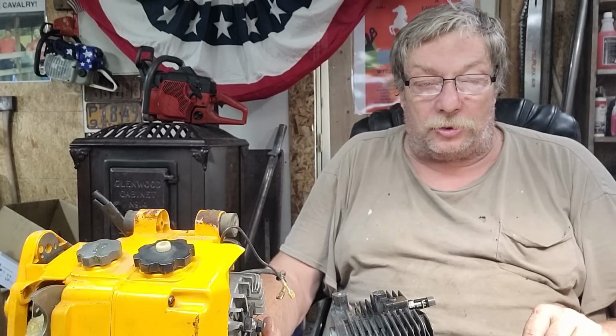You start crowding numbers too far in any direction, all of a sudden you start having failures. Okay? Yeah, you can crowd them more than I'm doing, in some cases. I seen one guy build a saw with an exhaust opening at 92 degrees, oh God, it screamed. It sounded so angry, it was nuts. Put it in wood, it fell right on its face. Didn't have any torque, because he didn't raise his compression far enough.